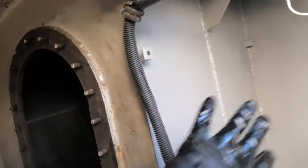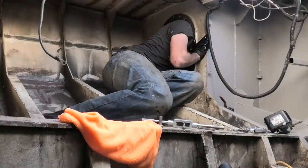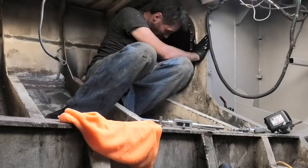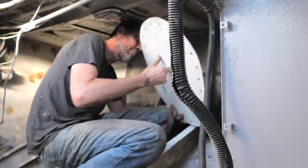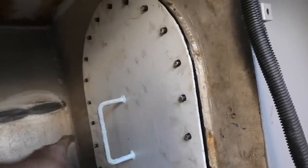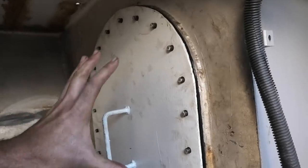I'm going to seal up the fuel tanks now so that I can continue cleaning in the engine bay without having dust going in there. I'm going to give the insides a wipe out with diesel and a rag. Then I'll pop this nitrile gasket on, put the cover on, and put all the nuts on finger tight, then torque them in a few rounds — probably 10 or 15 Newton meters first, then come round in a spiral and get it to sit as evenly as we can.